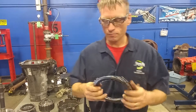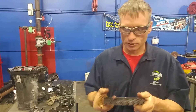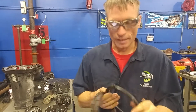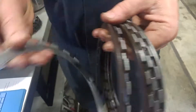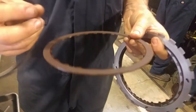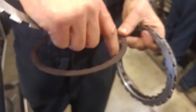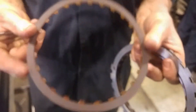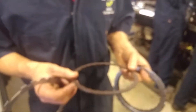The next component is going to be your low and reverse clutch and spacer plate section. These right here are your clutch plates and spacer plates for your low and reverse clutch. You're going to have your spacer plates, your disc plates, and then your friction plates. On your friction plates, you want to inspect the internal teeth to see if there are any bent or broken, or any discoloration or excess wear.